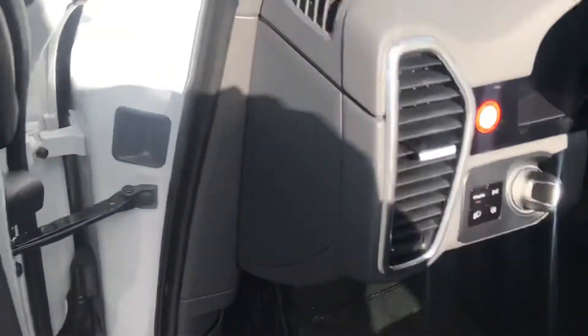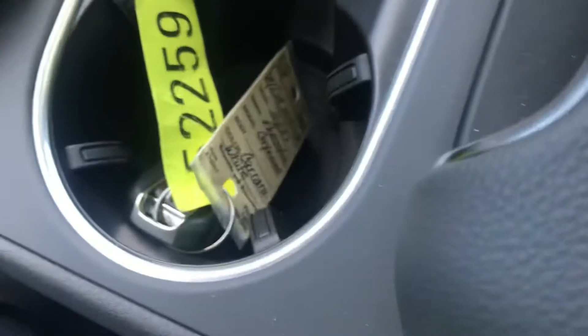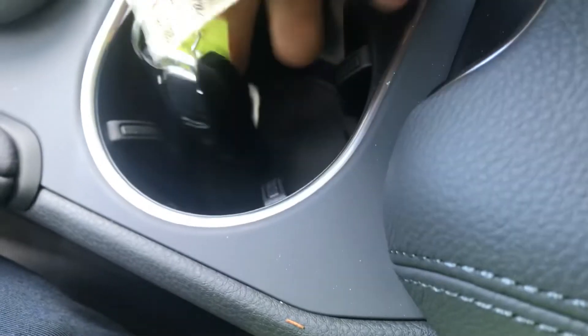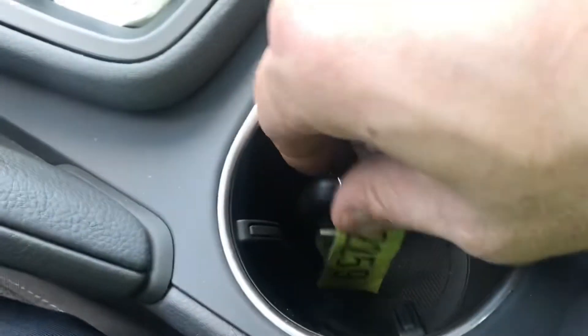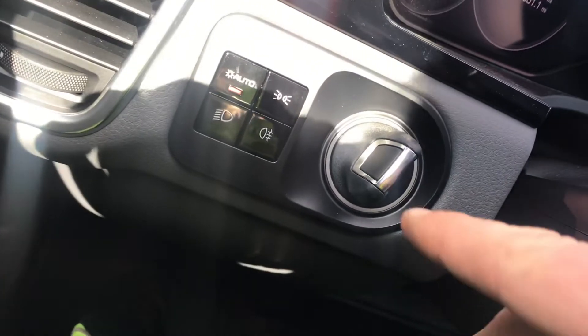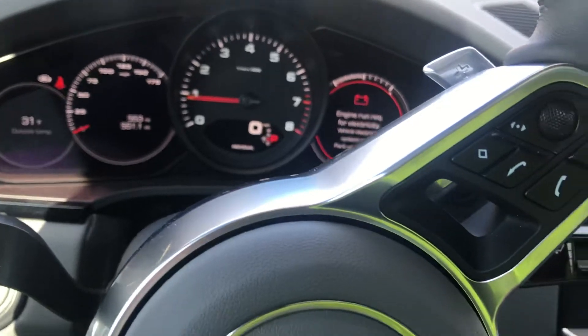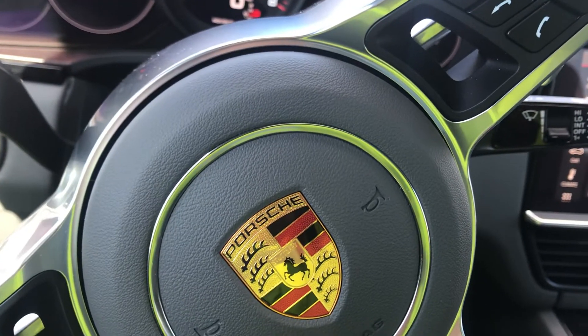Now when you go to jump start it, as I had to do, the car alarm will more than likely go off. In this little cup holder here you're going to want to take your key fob and set it in the cup holder just like that, with the little car shape up against it for proximity. Over here with the ignition you're going to turn the ignition twice and it will reset the vehicle and allow you to start it up — you'll be good to go.